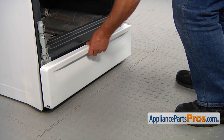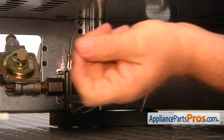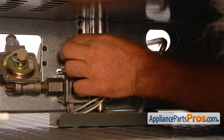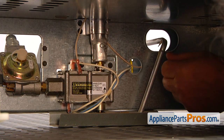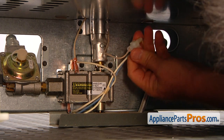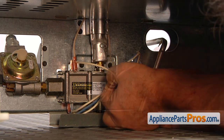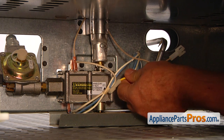We're going to remove the drawer — pull it out, lift it up, and take it away. Get comfortable underneath if you can. We're going to remove this wire from the gas valve and the second wire, pulling it out to expose the connector. Then we're going to disconnect the plug and pull it apart. Make sure that the end is not going to disappear in the opening, so bend it a little bit.